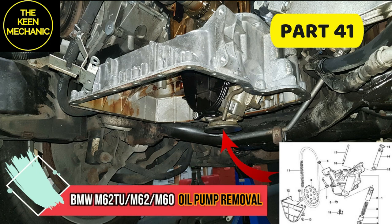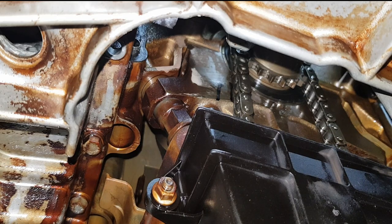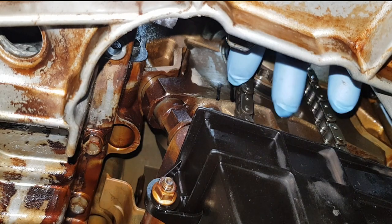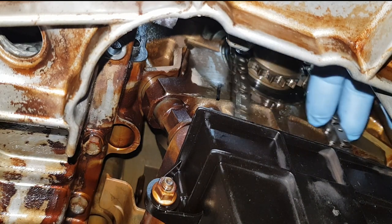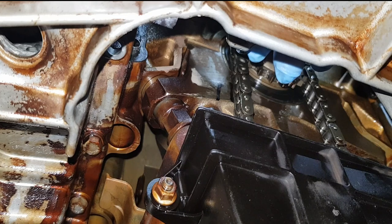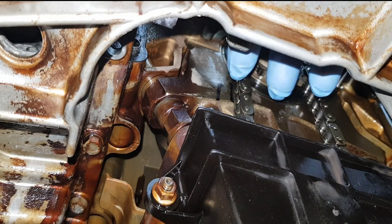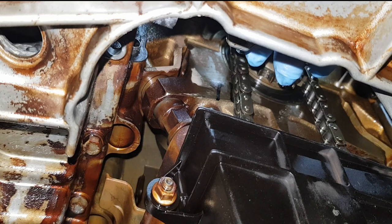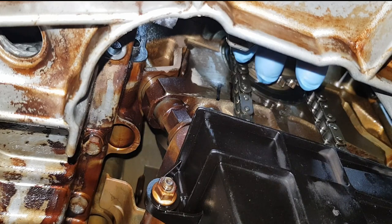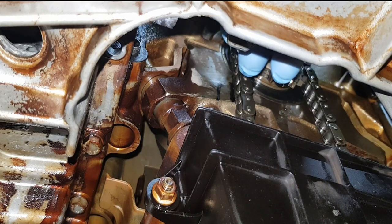Let's start with the chain tension first. It's very easy for me to show you this now because I have removed the lower timing cover, so I have space and I can film at the same time and just point from the top here. This is on the oil pump — this is a M62 TU engine, so it's the 4.4 liter V8 BMW engine. You have a little bit of slack here, and by the manufacturer standards it should be 10 millimeters plus or minus 2 millimeters, so maximum 12 millimeters of play. The way they show you in the book to check the tension is by moving the chain from left to right and measuring the gap.